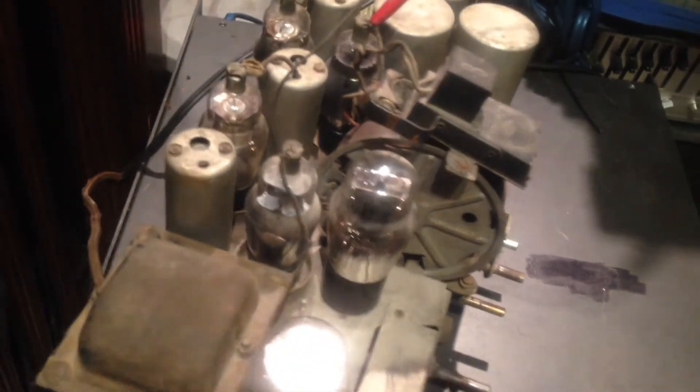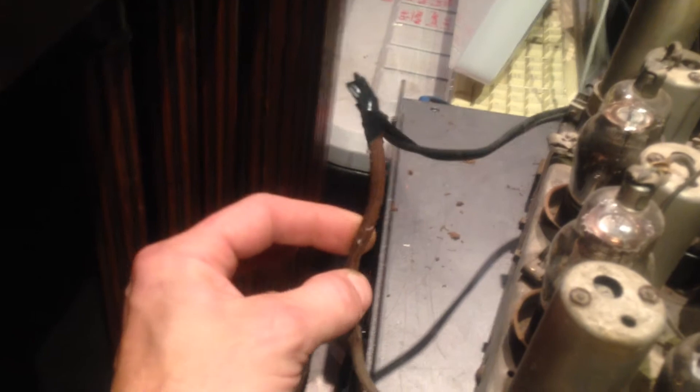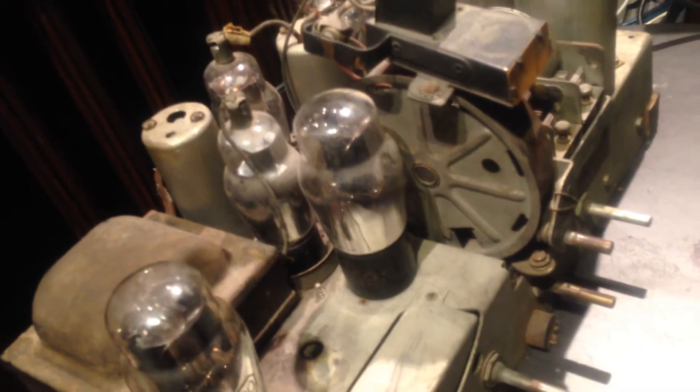Everything is pretty much original, it has some work done to it. It has a nice transformer. We've got a one, two, three, four, five, six tube set - wow, that's no more than the other radio we got over there. We found a 6A7 from the Detrola. I've got seven or eight tube radios. Anyway, it's late, I'm tired. I don't even know which one's hot and neutral in the radio - haven't looked. I tied it in several wraps in between the two, and that's going to go around to the variac. The dial cord is broken on this one.